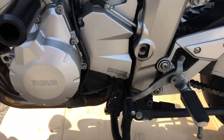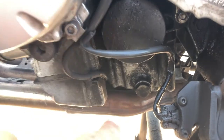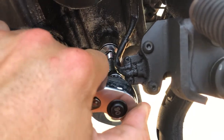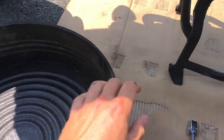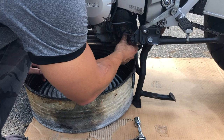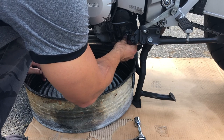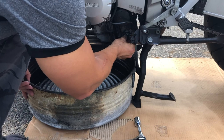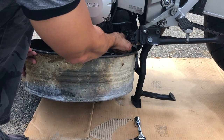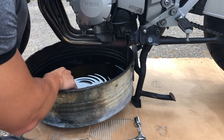Coming onto the left side of the bike, as if we were sitting on the bike facing forward, we're going to find the oil filter and the oil drain bolt. You can see the oil filter is right here, and the oil drain bolt is right there. We're going to take our 19-millimeter socket, get that on there, and just gently crack the bolt. Next, we are going to slide our oil drain pan right underneath there as best we can. And now once we have it loose enough to loosen it by hand, we're going to put our socket wrench down. A trick to reduce the most amount of oil spilling: loosen the drain bolt but actually keep a slight amount of pressure holding that oil back. Raise the drain pan up a little bit, and then quickly pull out the drain plug. And I don't think I spilled a single drop. Now lower it down and let all that oil drain out.